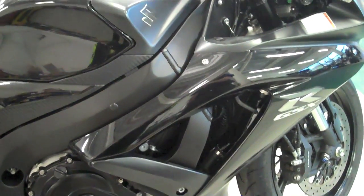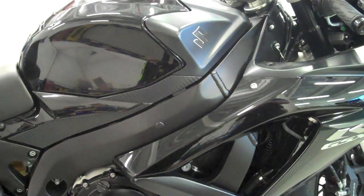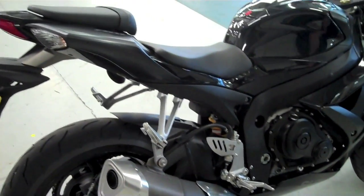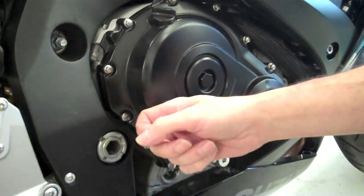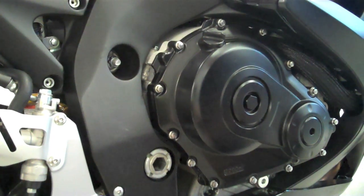So what's the core of this bike? Starting with the engine, you're looking at almost a semi-stacked gearbox unit, so the input and output shafts are above each other. That means the mass of the engine is very, very central on the bike — it does feel that way when you're flicking it around, very well balanced. What they've done is lengthen the swinging arm but kept the wheelbase pretty much the same. The swinging arm pivot has moved much further forward on the frame, which they can do because of the stacked gearbox. Previously the shafts were stacked behind each other, making for a much longer engine. The whole idea is to keep your mass as central as possible, making for a very neutral-handling bike.